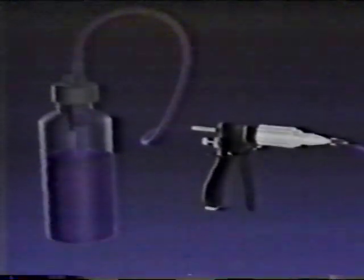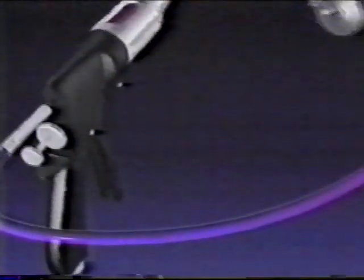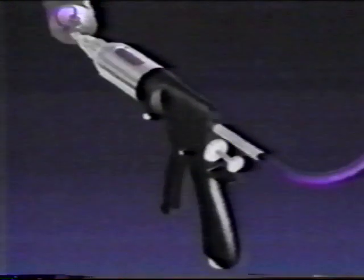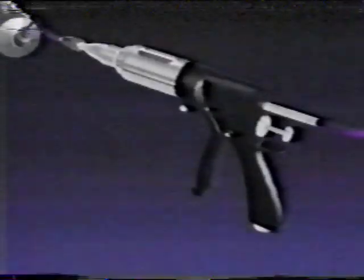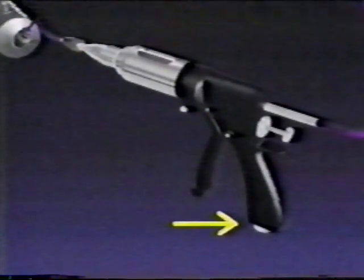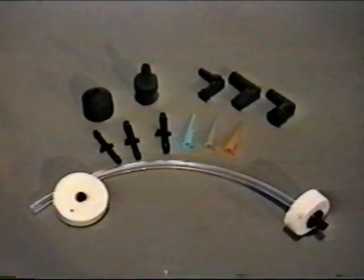The spring-loaded handle, when released automatically, draws fluid into the chamber, readying the injector for the next stroke. Each stroke can be metered using a manual adjustment. Depending on model, the return spring force is adjustable. The 10-pack module contains the basic equipment required to perform RFI, pressure and vacuum bleeding, or flush. Bottle caps are included, which attach to 90% of all brake fluid containers.